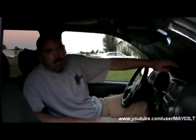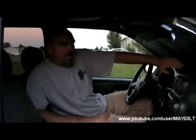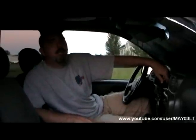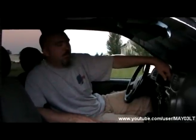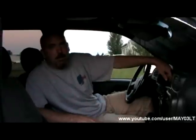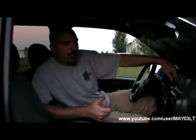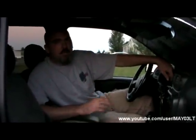Before you guys say wait a minute - what about air-fuel metering things, or flash updates? I've checked, there aren't any for this truck. This is more of an informative video - watch out because there are sharks out there. They have no problem saying you're going to pay us $105 for five minutes with a scan tool pulling up a P0420. With a little Actron tool that boots up in 30 seconds, you can have the code in under a minute. So you're paying $105 a minute.